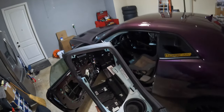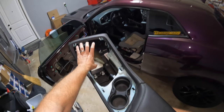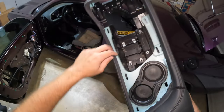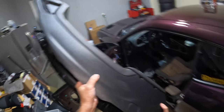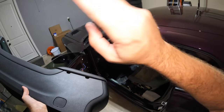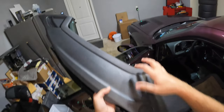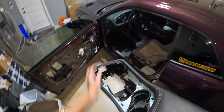The only thing I'm missing is this little bezel piece, because that gives me a place to put the buttons — but I think I'll be all right without it. The main thing is this is where the shifter module mounts, and that's what I need. I'm not going to show how to pull the center console out since I've already done that — I'll link that video up. Basically, there are a couple bolts behind these covers and a couple screws in the very front.